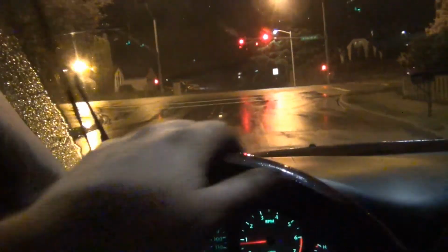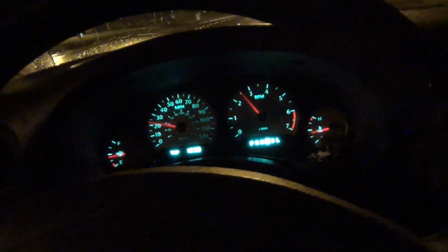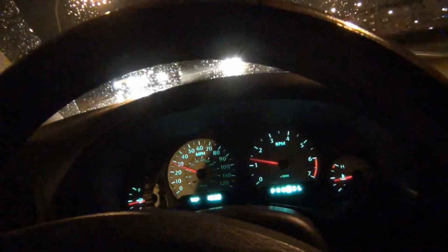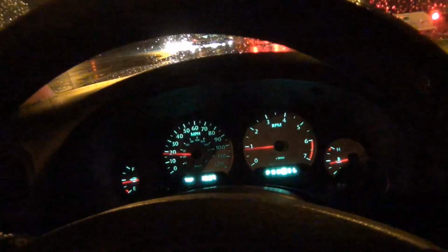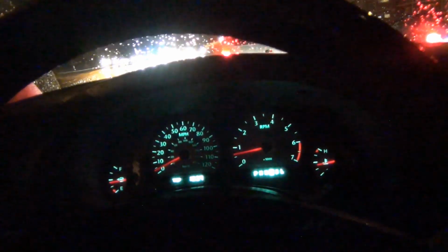Suspension's a lot better. It's got a little bit added capacity. Well, not really capacity, but what's the word? Damn e-brake. It dings every time, I think it's a check engine light. The air shocks don't necessarily add capacity, but what they do is they keep the car from squatting. So that's why we put them in there. So run a trailer and whatnot, it'll keep them from sagging pretty good. But I gotta go because I'm driving, so bye.